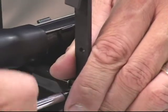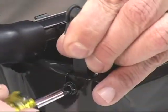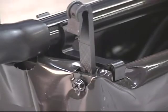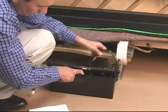Move the hangers down so that the holes align, and then refasten with the self-locking screw. If necessary, enlarge the holes in the plastic liner with a pair of scissors. Place the humidifier on the floor directly below the installed hanger rods.